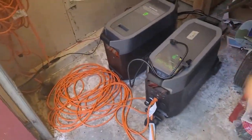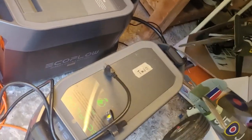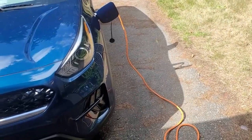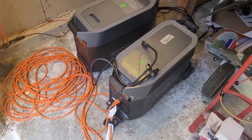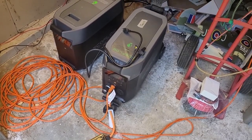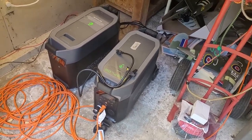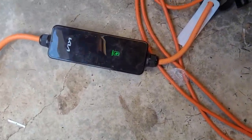I did something else — I was reading online and it said if you're going to charge a car from a solar generator like this, you need to get a grounding plug. So I bought one and plugged it in here. The reason you need it is because the car won't start charging until it senses adequate ground. So I'm kind of fooling the car. I don't think there's any danger because the generators are three-wired and everything is connected adequately, but you do need to run that.